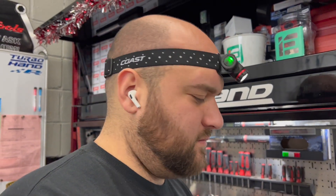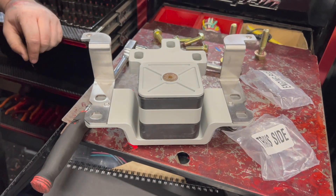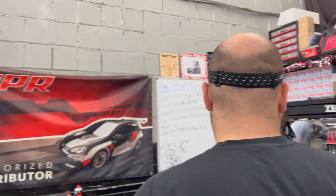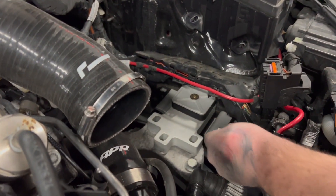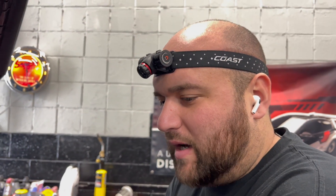Martin, what are we doing? We are going to do catless pipes and a catback system. We're going to remove the stock system and install this very high quality Rift Performance catless pipes. It's got the EGT bungs, the O2 bungs. The insulation is all molded and essentially welded onto the pipe, so the heat shield is already built in. Then we're going to install a full titanium catback — one piece, super light.